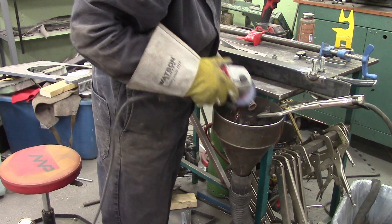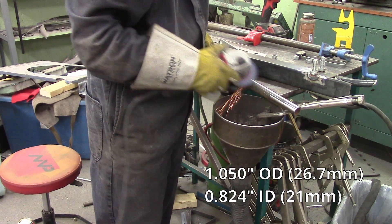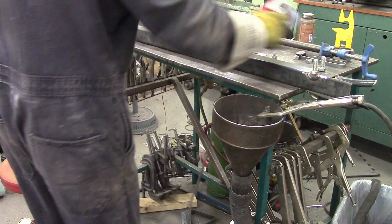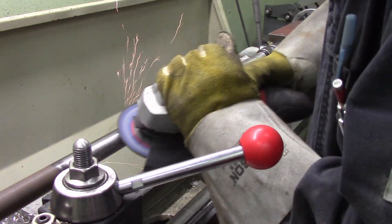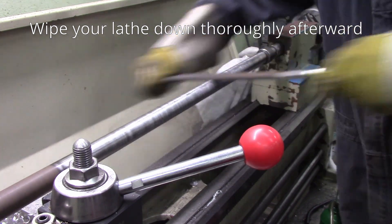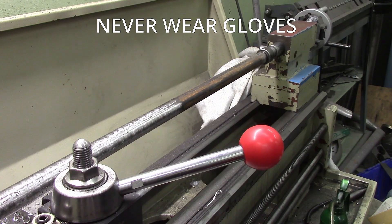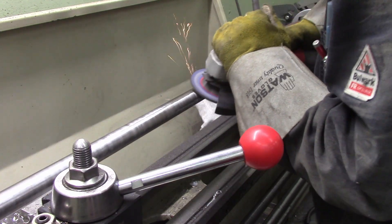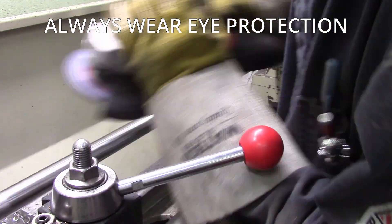So I picked up a piece of 3/4 inch schedule 40 pipe. And that got old pretty quick — the rust. Then I got a genius idea and I spun this up on the lathe with my grinder. I tried a file, but if you just slow down and speed up it worked okay. This did a really good job of getting it all nice and shiny and it worked really slick. Never wear gloves while using machinery — impulsivity is how we get injuries.